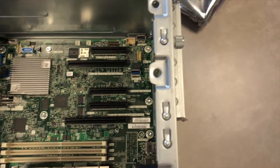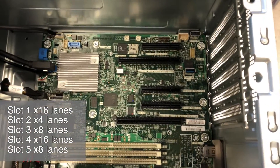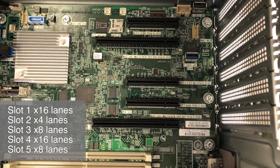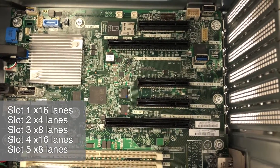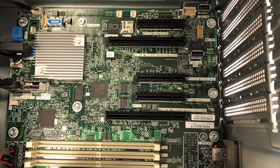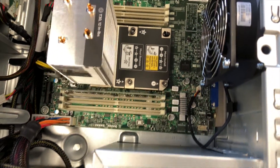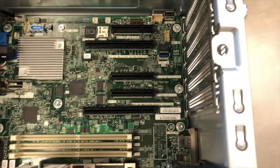There are quite a few PCIe 3 ports — it supports up to four of those. I don't believe they're at full 16 lanes; they're probably at least eight or four lanes each. That gives you plenty of additional I/O. They also say it can support a double-height and a single-height graphics accelerator, so if you're doing analytics or anything needing graphical acceleration, there's a decent amount of room for something in a pretty standard ATX package.